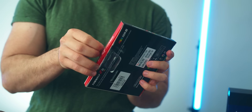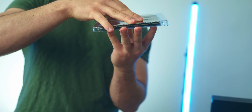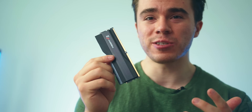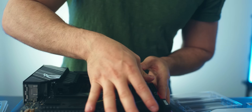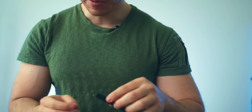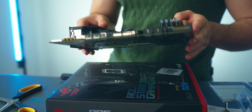The RAM is overkill, I get it, but this PC isn't for ordinary people — only those with enough responsibility can wield this power. This memory is really fine-tuned: 6,000 MHz, CAS latency 30. The goal is to maybe push it to 6,600 MHz with CAS latency 30 on the 13900KS for even more performance. We're going to populate each of the RAM modules. There's no way to remove the heat shield from this, so we're just putting it in as is.